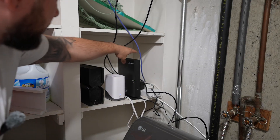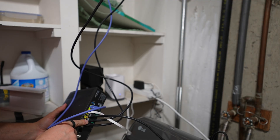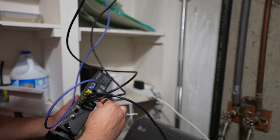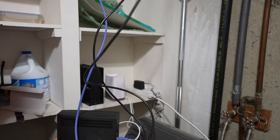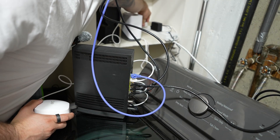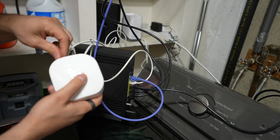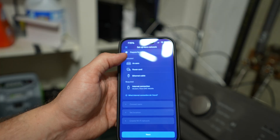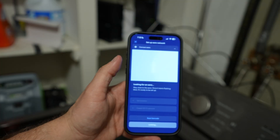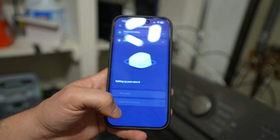As you can see it's a bit of a mess over here, but I'm going to do my best to show you. This is my main router right here, and in the back you have these extra ports. For mine, all my ports are being used, so I'm going to unplug the one I don't use that often — the one for my security camera. We're going to unplug that and plug in the provided ethernet cord, then plug in the USB-C into the main node and into a power source. On the Eero app it's going to walk you through the steps. Because ours is flashing white, we should be good, and now it says the Eero 6 is ready to connect.